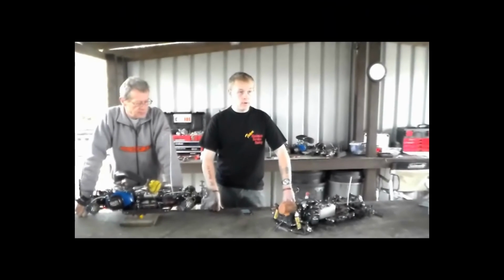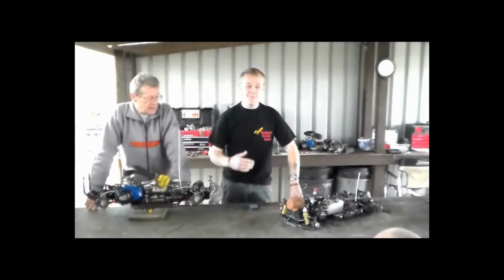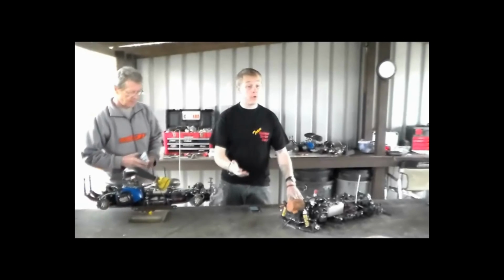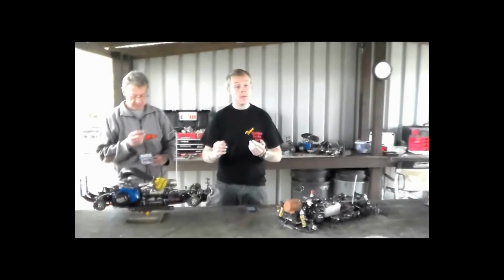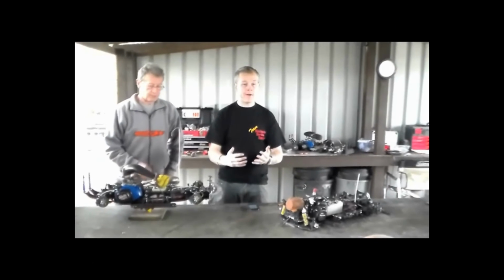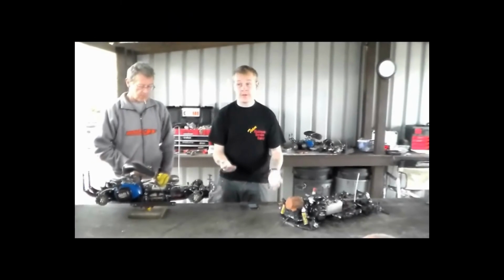Over the years, as I've gotten more experience, I've changed my braking style. I used to have it so that when I braked, I had that initial braking, but if I turned while braking, the brakes would actually release, because I wasn't a good enough driver that I could brake first, then take off the brakes and then turn in. I just wasn't experienced enough.